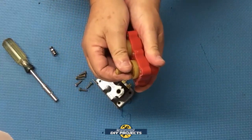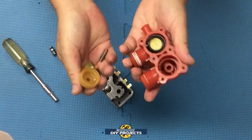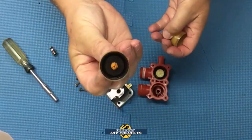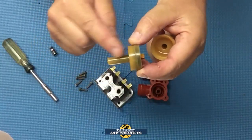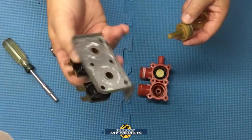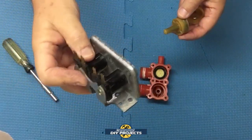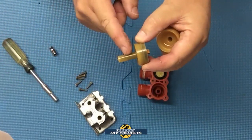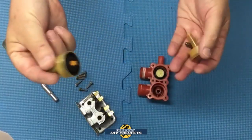And inside here, you get some plungers, and obviously, here we have an intact plunger right there, and it's just a plunger, probably has a magnet up here somewhere. These little solenoids probably change from positive to negative. You can see they're smooth inside. There's nothing inside there. So they probably change polarity, and then causing this to go up or down. Depending on the polarity of it, it drives the magnet up or down, causing the plunger to allow water in or out, depending on what you need.